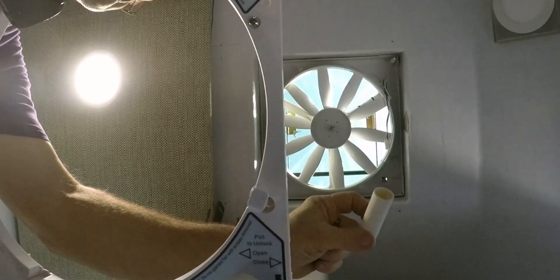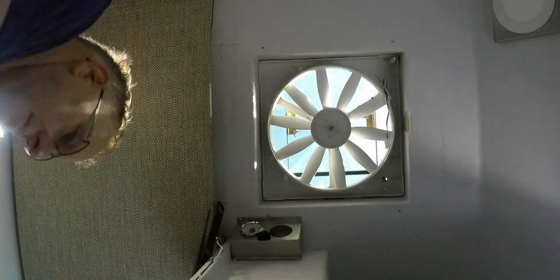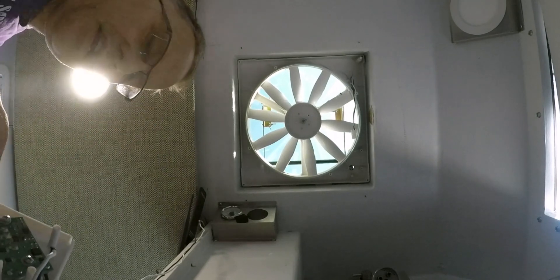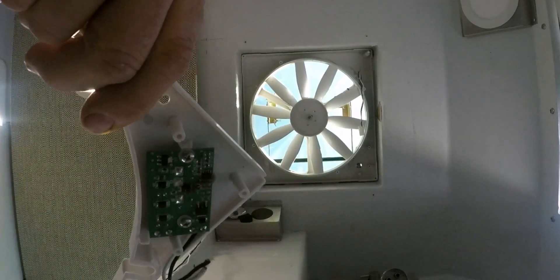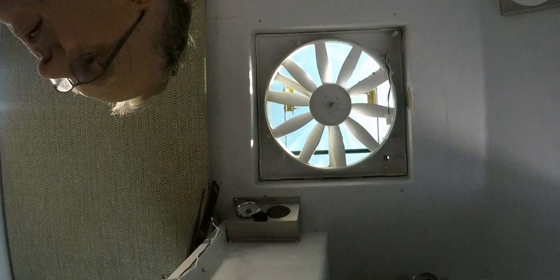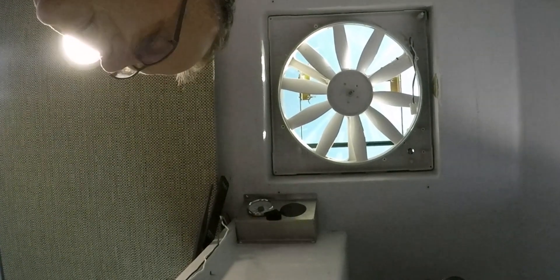One of the things also in here is a plastic sleeve that goes right onto here. It's a little bit difficult to get back in, but that's all that's necessary to take it out. Now I'm going to take this into the shop and show you what is necessary. I'm also going to replace — if you can see — the burn spot on the controller. MaxAir decided it was not necessary for this controller to tolerate more than 13.8 volts, so when you're charging in your camper the system voltage goes up significantly above 13.8 volts and will burn these out. You can't charge your battery with a MaxAir fan. But evidently MaxAir has rectified the problem and they're now shipping out controllers available under warranty — I had two of my fans fail, and that's what I'm repairing now while adding the reversing switch at the same time.